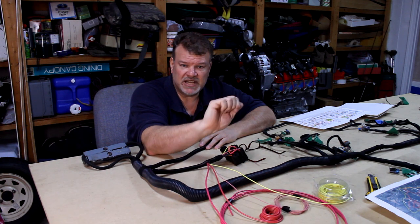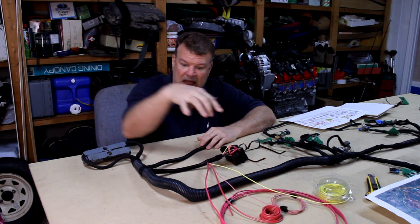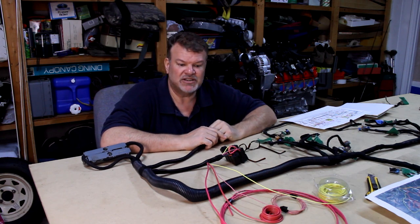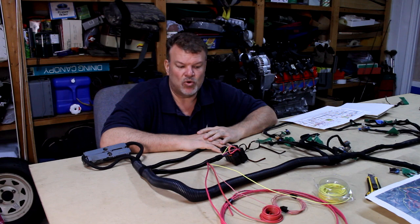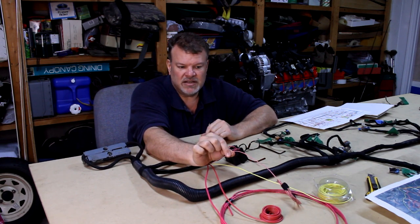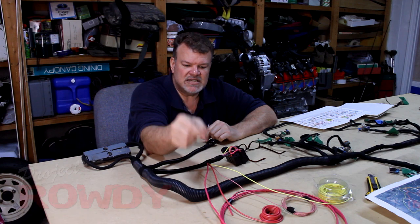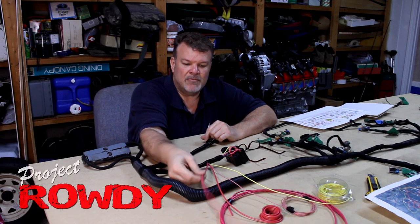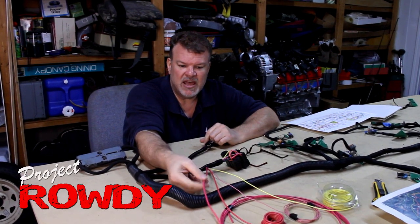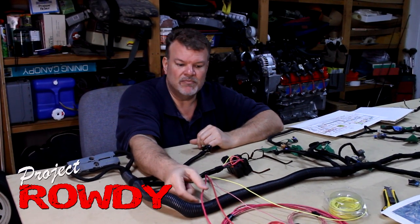This pink wire needs to go to the ignition switch when it's in run position — that's from off to that first position. That's when it needs to be hot because it powers up the PCM and provides ready power for the injectors, coils, and everything related to the engine in run. Then, when that same key is put to the third position — start — there's 12 volts hot on some wire in the Jeep that I want to connect to the purple wire, which goes down to my starter to start the engine.